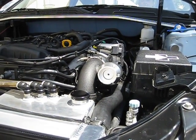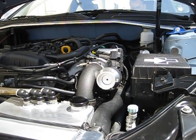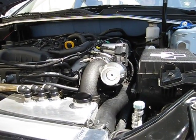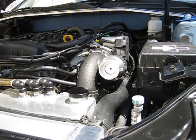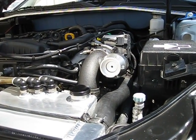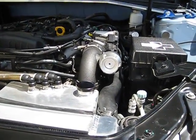Go ahead and shut it off. Now key on, but don't start it. Just stab the throttle. We're on key-on and the factory ECU just did that — controlled the blow-off valve. Stab the throttle again. That's full ECU control.